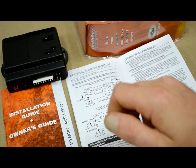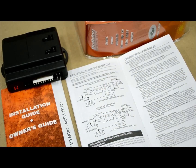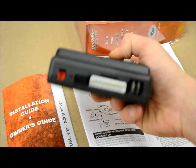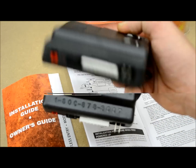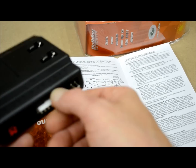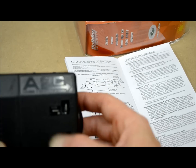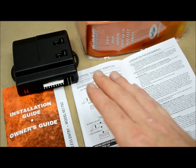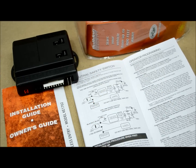At that point, release the brake, take the key out of the ignition, and get underneath your dash. You should already have this main brain module handy. Unplug all your harnesses from here. So you've got this secondary harness, this plug over here, all your powers, disconnect all that stuff. Leave it alone for about half a minute or a minute or so. What this is going to do is tell the brain, once you plug it back in, to start looking for a new RF code automatically.